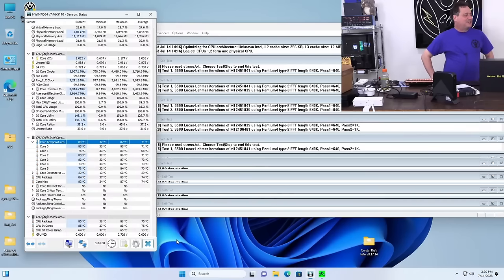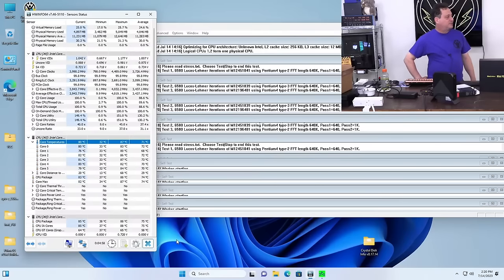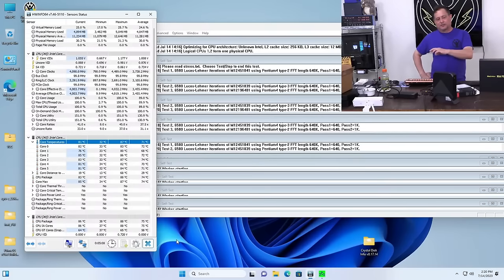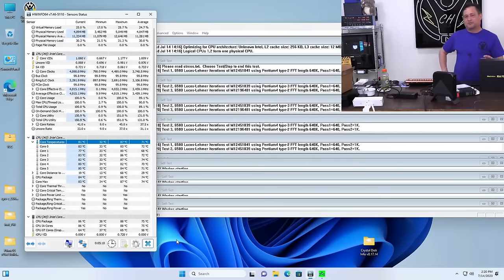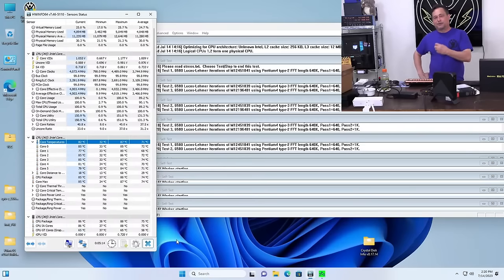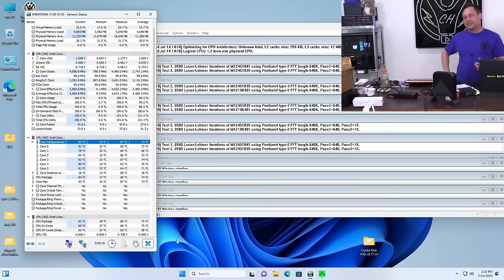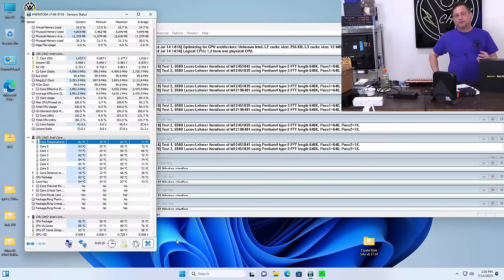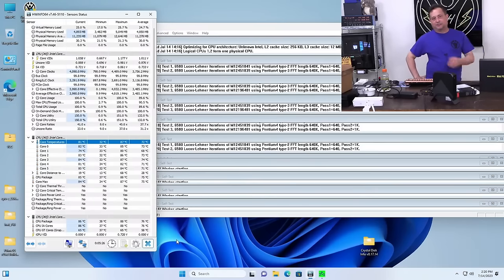David Dix at Rock City PC said, yeah, I just checked my Dell XPS. It's an 11th gen, and it does support Gen 4 M.2. In fact, he's got dual Gen 4 M.2 slots. Thanks for double checking that for me, David. Universally across the board, the 10th gen Intel chip just did not support Gen 4. When AMD came out with their line, they were supporting it a good 6 to 8 months before Intel. It was very disappointing for me when the 10th gen came out that it didn't support Gen 4. But it absolutely is supported on 11th gen across the board.